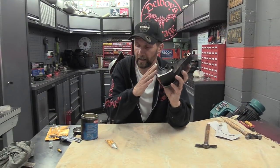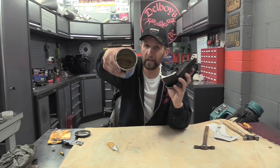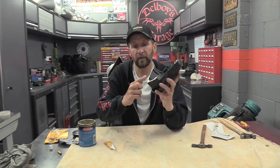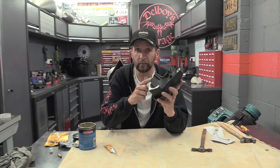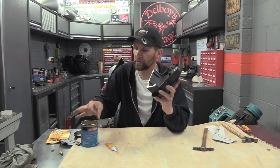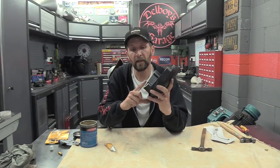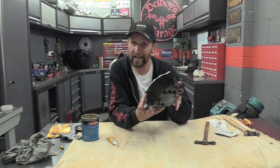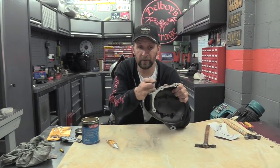Use the Hylomar on the casing so it's stuck to the casing, but use regular ordinary grease, just ordinary LM grease, on the other side. Now that will still seal on a light casing, that will still seal just fine, no problem at all. But the benefit there now is that when you put that on the engine, bolt it into place, do the job, etc.